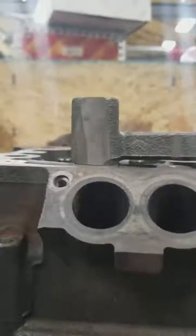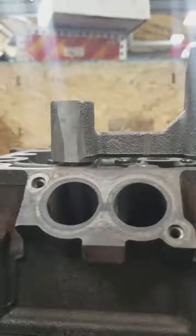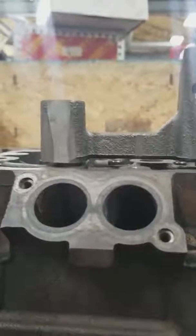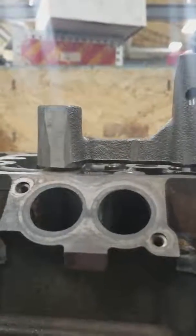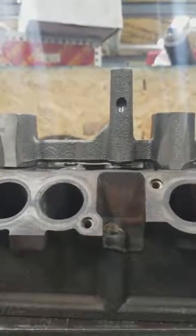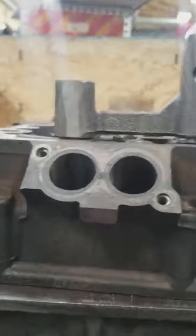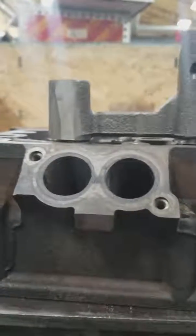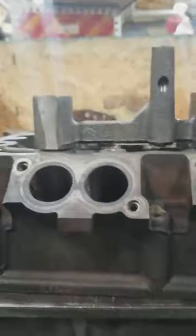It would keep the valve staying open on both intake and exhaust. But Ford Motor Company, all they want to do is pay $150 for the labor — and that's max. The cab had to come off the truck, the head had to come off the truck. This could have been just a pedestal replacement, but what happened was it damaged the lifter. The lifter is still operable, but it bottomed out and messed up the seat in the lifter so it's puking oil out. Obviously I can't send it out like that, so we have to pull the head off to get to the lifters — which is extremely aggravating, especially when it was a brand new part that was just machined wrong directly from Ford.